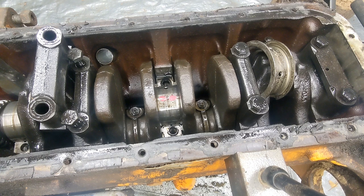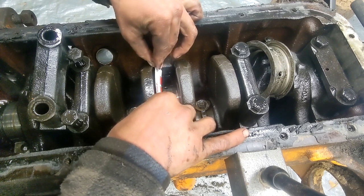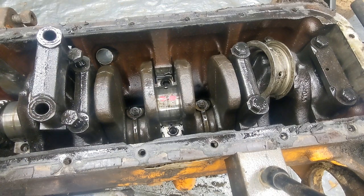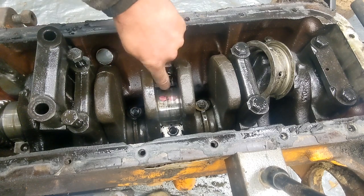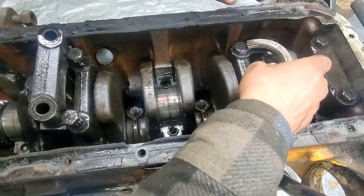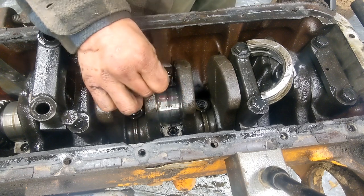That's not as bad as I expected. That's the inch scale. Between two and one and a half - that's actually within tolerance. I think if I'm remembering right, it's between one and four. Huh, that's interesting. Seeing bearing material literally melted in there doesn't seem like a good thing, but it's still not actually out of spec. I'll clean all this off.